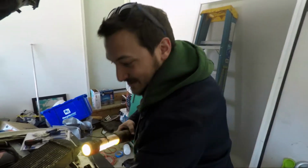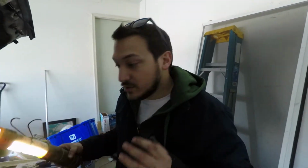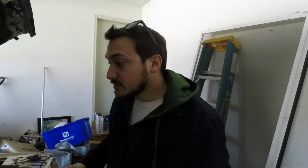So what we learned from this is we're going to have to put a real catch can on the car. Right. And we found out where the PCV system is, and we're going to hack into it and put an eBay catch can system to work with it. It does have a vacuum line running to the intake. So we are going to splice it into the middle, still keep the same hoses, so we still have some vacuum coming through and working properly.